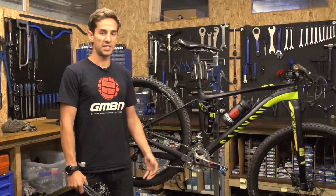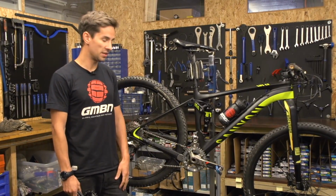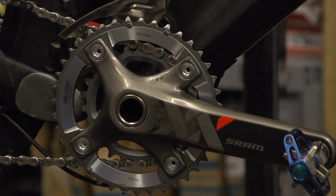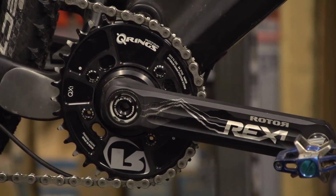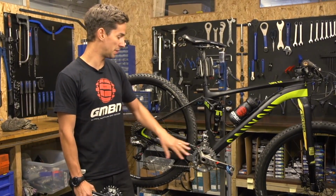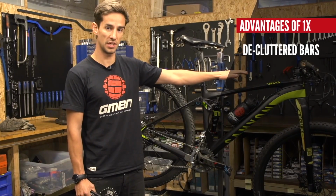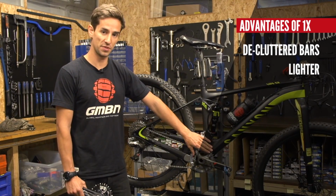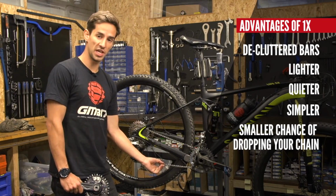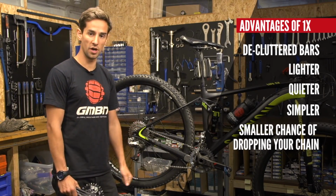Yeah, I'd say so. And at that point, let's just throw into a video all about how to install a single chainring. In today's video, I'm going to show you how to convert to a 1x setup. By that I mean changing from a dual or triple chainring up front to just a single. Why would you want to do that? Well, it's a much simpler system really. You're dumping your front mech, front shifter, and getting rid of those chainrings obviously. To me, that really works because you can run a much shorter chain, makes the bike that much quieter and easier to use.